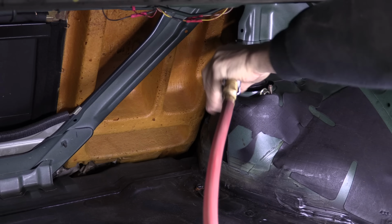Based on the parts that were annotated inside the drawings, this is a secondary power steering pump. I guess I'd have to take that loose. And it's held in place just by an O-ring and a single bolt. The banjo-style hardline has to go, and it really didn't manage to put up anything resembling a fight at all. I took all that fight right out of it using the right precautions. Technically, that was enough to free up the differential so that we can drop it.